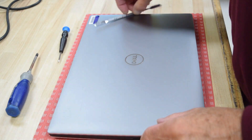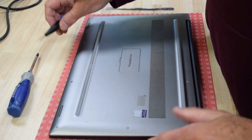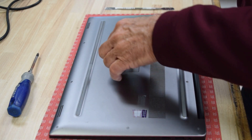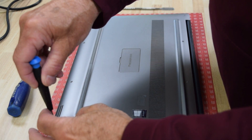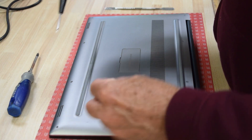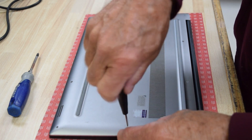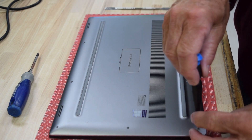The tools you'll need are shown on screen. First thing: turn the laptop upside down and undo the screws on the bottom. These are very small screws — there are two in the little trap door, and those are regular Phillips. Be careful not to drop them; they're hard to replace.